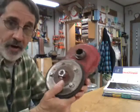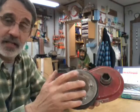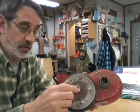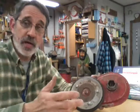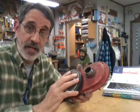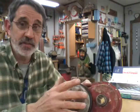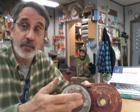This chain case is an old style that I designed after a comet. The comets back then didn't have the slipping clutch like the new ones do — that's why I got the idea of bolting my clutches solid so they don't slip anymore. But there are some things to try before you do that. There are springs in there you can tighten to put more pressure between your clutch disc and your drive disc. It is a little dangerous if you have kids — let that clutch out too fast and you're going to be popping wheelies, which puts unnecessary stress on all these parts. Try the springs first.